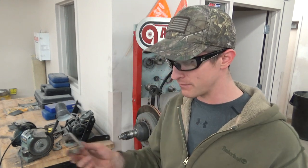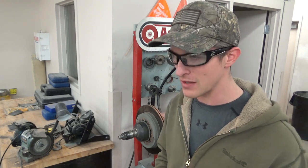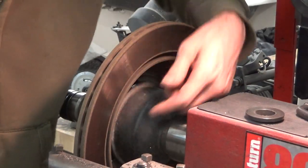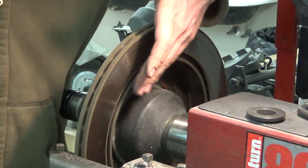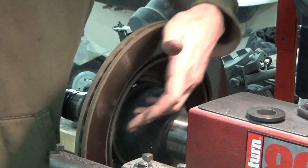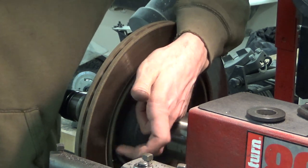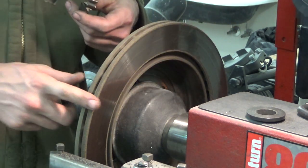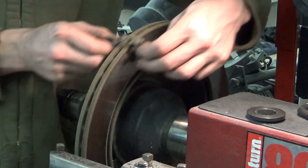So what I did is I returned it to a perfect circle. I'm going to show you on the old rotor exactly how I did that, because I've had this problem happen on a couple of cars, and this is how you fix it. Typically on a drum, this portion in here is where the parking brake is, and on this disc it's recessed. If it's rubbing on the inside and your parking brake is correctly adjusted, typically I machine just a smidge off of this edge here. But in this case, it was this edge that was making the noise on the abutment hardware.